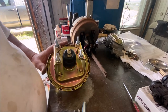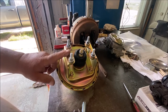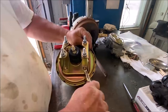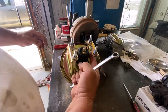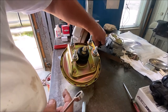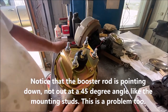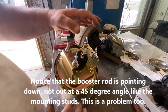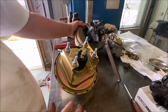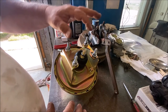So, this is what I did so far - I'm going to try to put this booster on the firewall with these brackets. That will make the booster point up. I've got these tight, I put the brackets all the way up. That brings this down because the rod is down. Now I've got to know if this is the same spread as the bracket - the spread of the holes on the firewall.